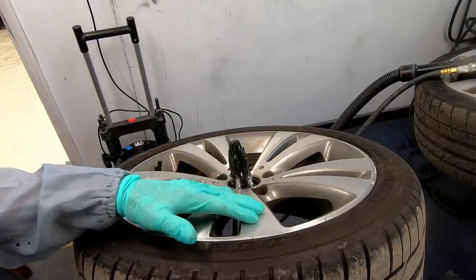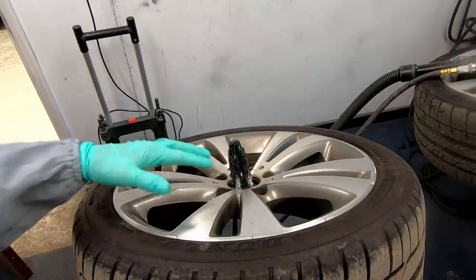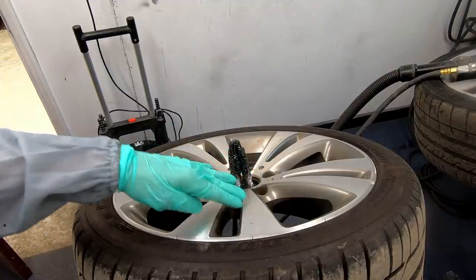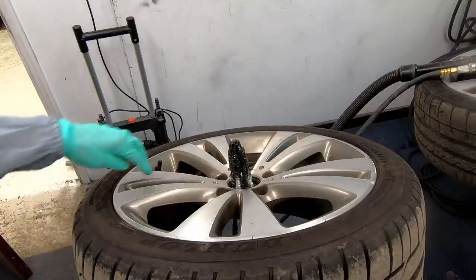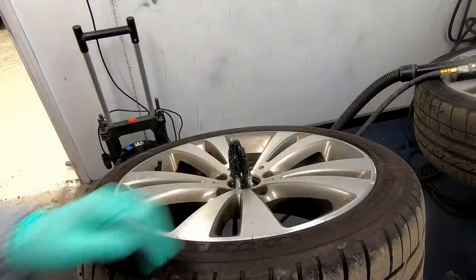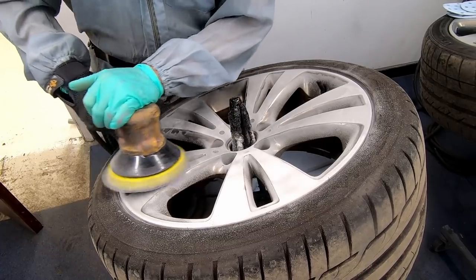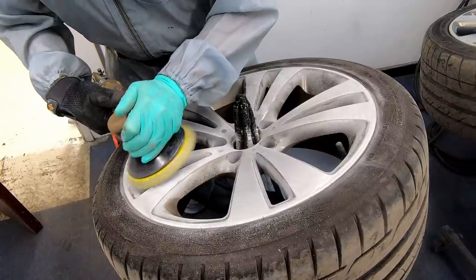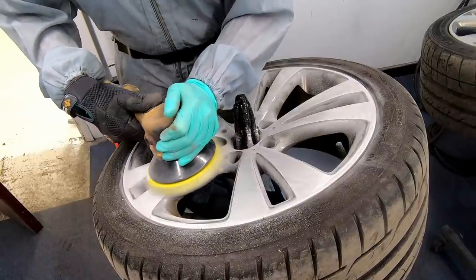These alloy wheels are polished face, meaning they've been powder coated originally from the factory - that's the grey area - and then put into a lathe which skims the top edge giving it the shiny finish by taking off a very thin layer of metal. Once that's done they lacquer over the wheel and that's what gives it the shiny finish. The only problem with this is any slight chips and it starts to craze, as it has here, and we've also got a bit of curbing on the right-hand side. I'm using a dual-action sander with dust extraction and a 240-grit sanding disc - it's almost like exfoliating, just taking the dead lacquer off the top of that polished face leaving the shiny metal underneath.